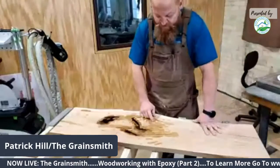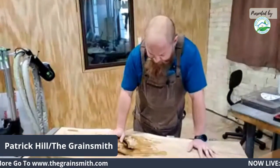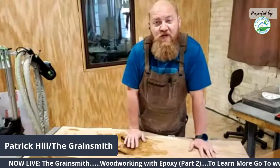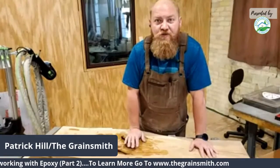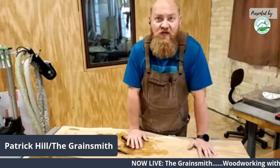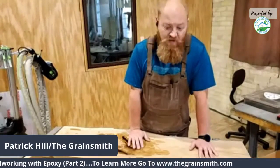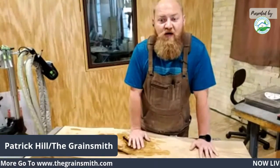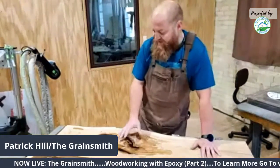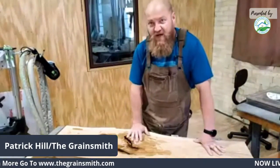Now this stuff, I relate it to a plexiglass. If you scratch plexiglass, if you take a sandpaper to it, it instantly goes from perfectly clear to cloudy and you can't see through it. Same concept here. The way to get the plexiglass totally clear again is keep sanding it to a higher and higher grit, and eventually it'll become clear again if you go high enough. The higher you go, the more clear it's going to be. I tend to find that about 500 grit is the top of really what you would need. And I'm, again, a bit of a perfectionist when it comes to some of these things, and get a little anal over trying to make it crystal clear again.